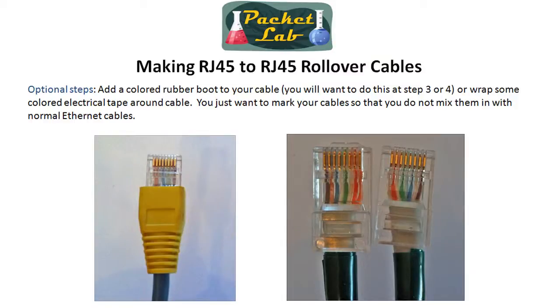An optional step is to add a colored rubber boot or just put on some electrical tape — I've done both. Here's when I was making the fancy ones. This is actually a crossover cable, but I know now that all my cables that are blue with a yellow boot are crossover cables, so if I accidentally mix one into production or somewhere else in my lab, a quick visual check shows me that's not a normal ethernet cable. If you order the boots online they're not that expensive — I got them at a local store and it was like 15 bucks for 20 of them. They're nice but not really necessary; a cheap bit of electrical tape does just as good a job. I've got these marked with green electrical tape so I know they're rollovers.